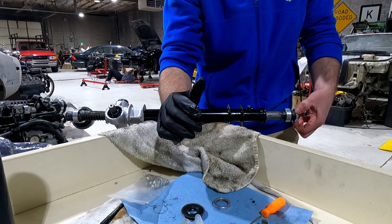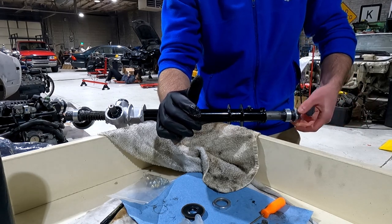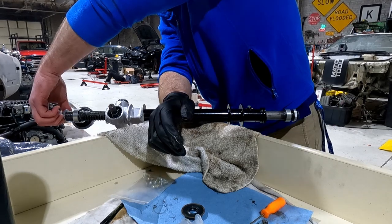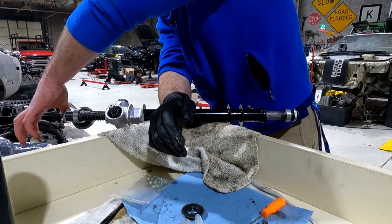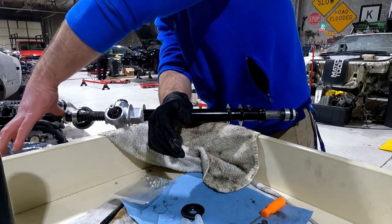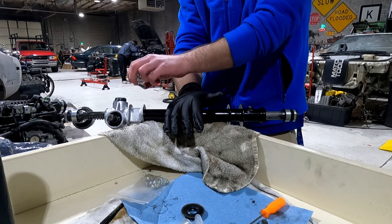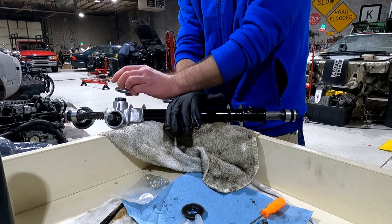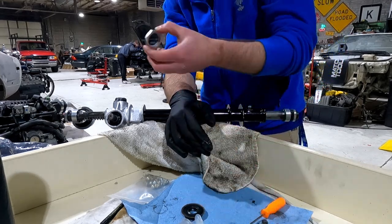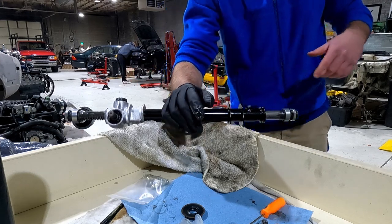Then we've got the lock nut for the actual inner tie rods. Just gonna get those threaded on so they're ready to go when I get the tie rods in. Make sure the threads are nice and greased so no rusting, but these will have boots, so there shouldn't be any water getting in anyway. This is the lock for the tension bolt here. So that will go on to lock it so your tension doesn't change given certain situations. So I'm going to wipe this off, get a lot of this grease off, and then I'll put that on.